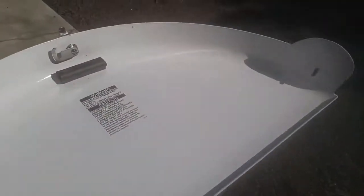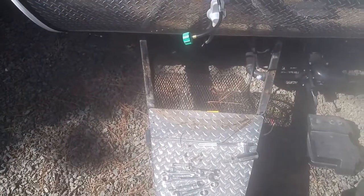We have the frame out — there's the frame. I'm going to put the plastic back on the trailer and adjust the frame so that it clears. I want to show you this — this is one of the big problems. This is the lid, and that's the hinge. It's just one of those plastic pushpins that hold carpet down — that's what's holding this entire lid on. I can't imagine at freeway speeds that's adequate. No wonder I've heard so many stories of people losing these lids. So before mine comes off, I'm going to do something about it. We're going to mark everything so I know where to drill and bolt it back down, a little bit farther forward inside the plastic piece.